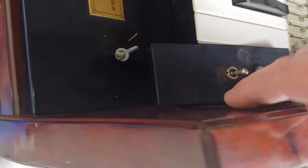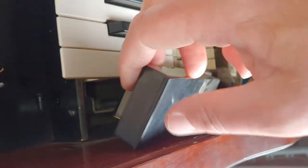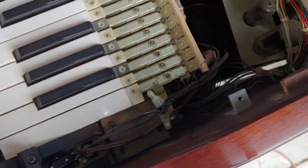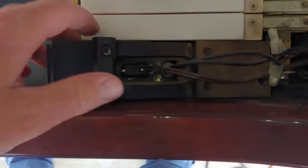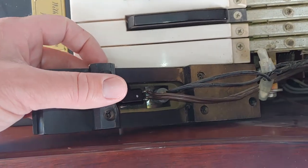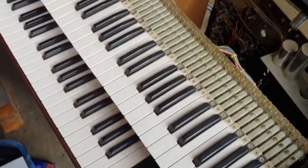The power button — there was a screw here and a screw in the front. I took that out, and just to test it, there are these two leads and I jumped those to make it permanently on. I jumped those, plugged it in, and it turned right on.